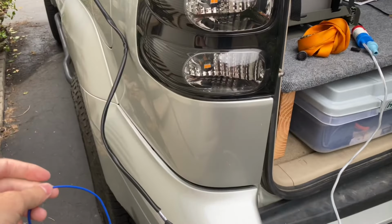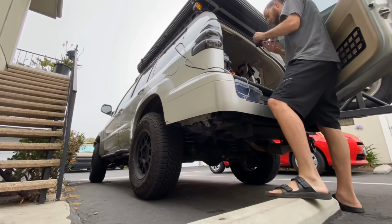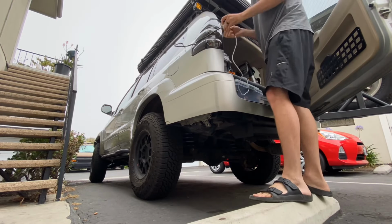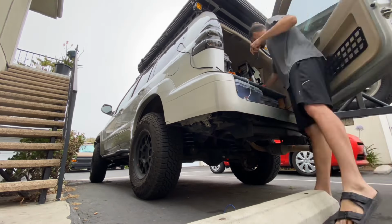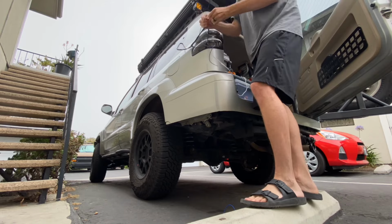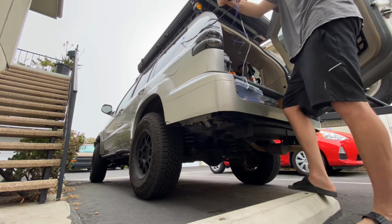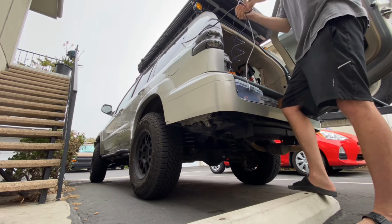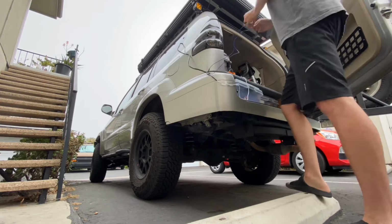Now I'm getting the wire for my switch, and I'm going to see if I can go ahead and split that positive wire up, putting it into the switch and out of the switch so that I can control when the water pump is powered on and when I want it off, because you definitely do not want to just leave the water pump running with a valve for the water closed. That's a quick way to burn out any sort of electric motor.